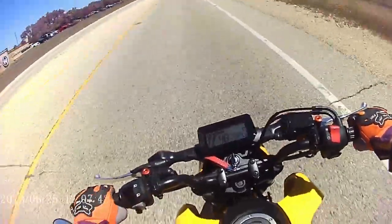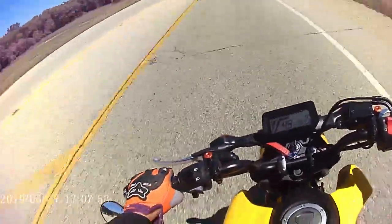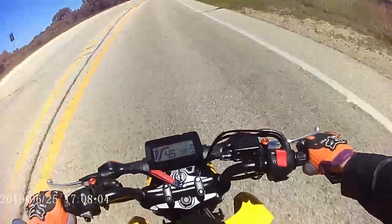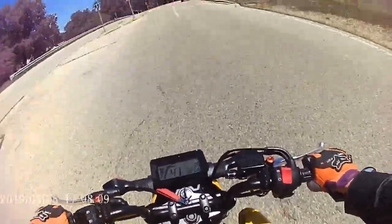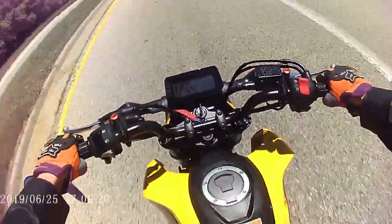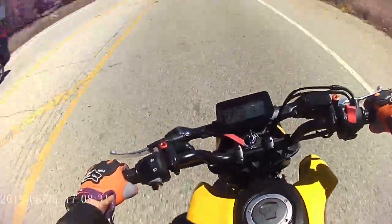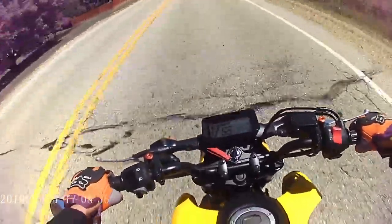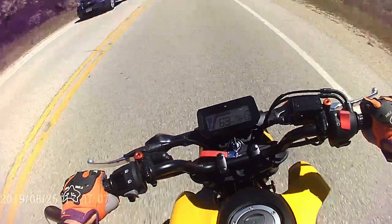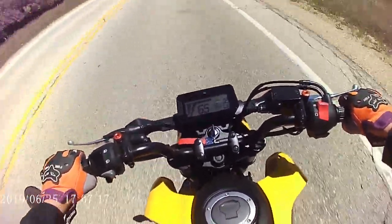Just going back to the dyno curve, if it's from DHM, if it's actually even accurate, what I would suggest is to just buy a cheap eBay exhaust that's open, doesn't have any of the baffles or restrictions that stock has. And you should probably be really close between the red and the green line. Getting to the blue line, that's a really nice difference between the blue and the red line, almost a horsepower at that level. So that's the cam. I would say do the cam.